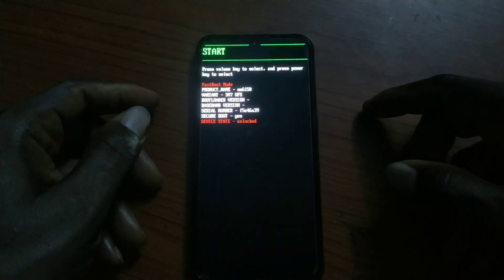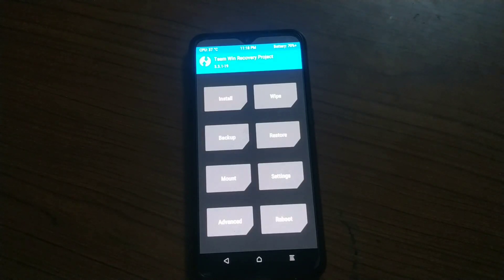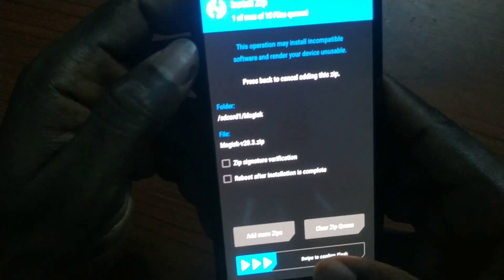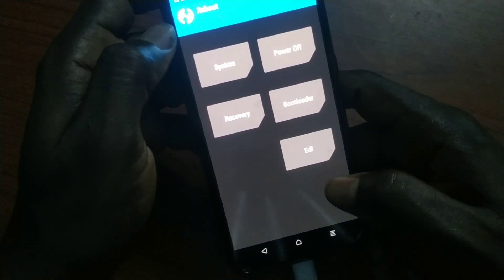But when this issue came to my attention of breaking phones and fingerprints, I decided to replicate the same problem. So after I flashed MIUI, I went back and flashed custom recovery TWRP, and then I flashed Magisk, which is the root tool — that's the way you root.